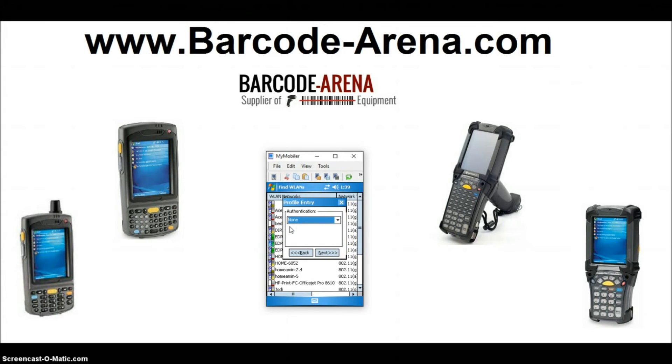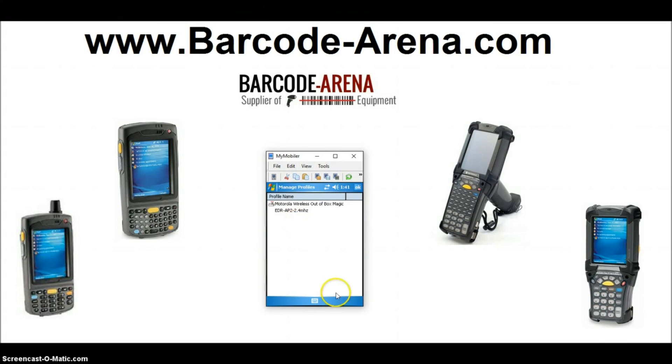For Authentication, set it to None — this applies whether you're doing WPA, WPA2, or WEP. For Encryption, we're using WPA2 Mixed Mode which is AES encrypted — check with whoever manages your access points whether you're using TKIP or AES. Select AES and click Next. For IP address, use automatic DHCP for the easiest setup, or static for advanced networkers. Leave Transmit Power at Automatic, set Battery Usage to CAM for highest performance, and click Finish.